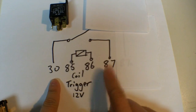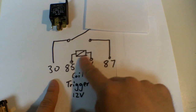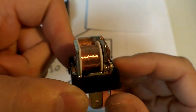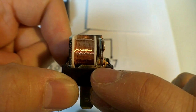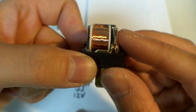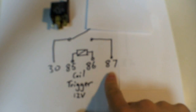In this diagram, this is the mechanical switch portion of the relay. Right now, because the coil is not energized, this switch is in the off position — there's no connection. You can see the switch right there, and right now it's in the off position. There is a spring that keeps it off until you energize your coil. The coil will then become a magnet, and because this is a piece of steel and it's magnetic, it will pull the switch closed and complete your circuit — pins 30 and 87 will close.